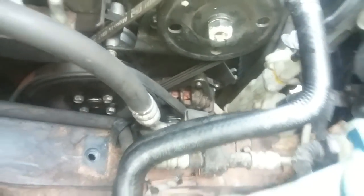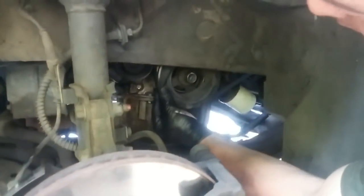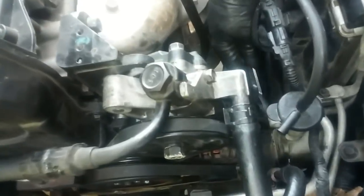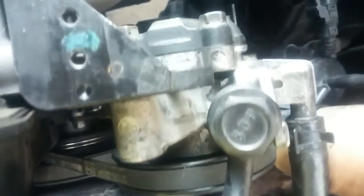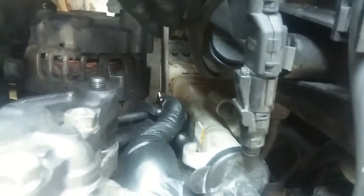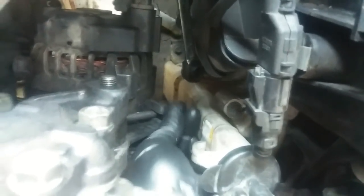I'll move the alternator up. Okay, belt is on. Now we'll apply clockwise motion to the alternator adjustment bolt until we get enough tension on the belt where the belt doesn't move more than 45 degrees when you twist it. Once the proper tension is reached, you secure the locking nut which is right above the adjustment bolt, and that will prevent the belt from moving.